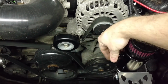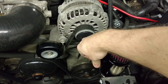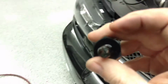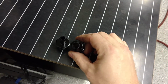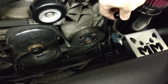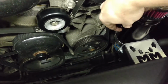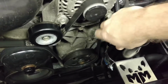I actually need to get rid of this fitting. So this would be an upgrade. Say, oh, I was stock and now I've got a built motor and a turbo. So you take this little guy off as a prototype, excuse the raw aluminum. We're switching to a number 10, and a number 10 isn't the biggest one I sell. I have a number 12, and we can actually fit 2 number 12s on the can. But we're not going to get that wild. Maybe do something with a leaf blower in the future. That sounds fun. I don't have a leaf blower.